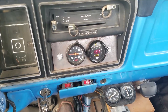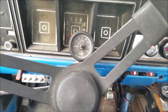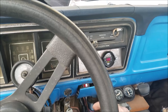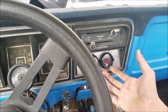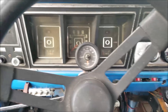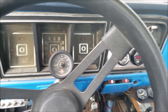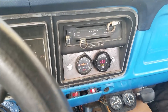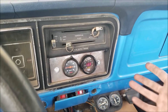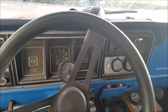I've got a few things to pick up here off the dock, so it's going to give the truck a little bit of time to idle and really heat soak, just like what you'd have in traffic. I'm going to jump down and load that up and just let her run the whole time. As you can see, that fan is blowing hot air from the radiator right at the carburetor and we're starting to lean out. When you rev the engine and get some fuel moving through that carburetor, it's going to richen up again because you're pushing that hot fuel out.